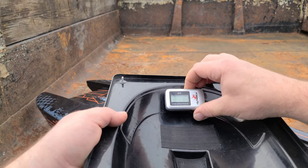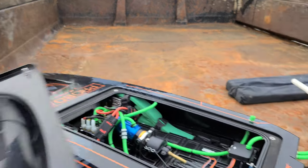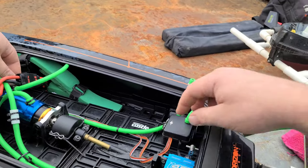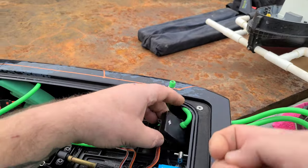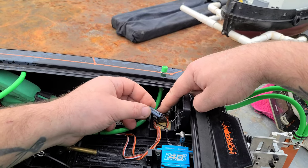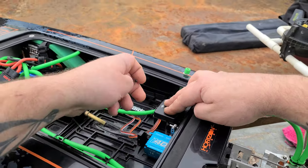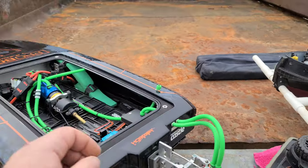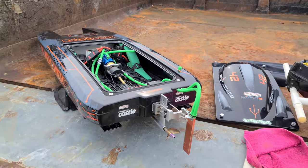Got both GPS units recording. I actually just installed a Power HD glitch buster on the boat. You guys see this right here — this is a glitch buster, Power HD. I got it from Offshore Electrics. It goes into your auxiliary channel on your receiver. I was getting some glitchy servo with the XLX2 here lately when I give it full throttle.